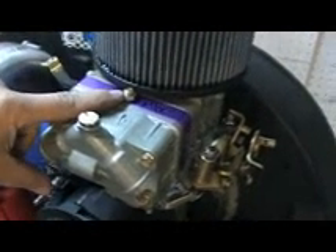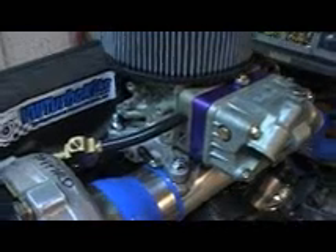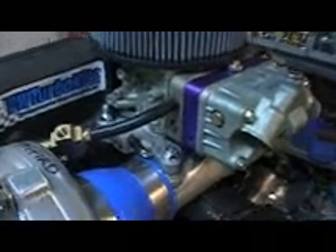You'll actually never take apart the carburetor to change jets because there are no jets. Because of the main jet using a turbo-adjusted jet, if you want to richen it up or lean it out, you just turn the jet. Because it is boost sensitive, it has a normal idle circuit so it doesn't load up like the old-time problems typically when you run Holleys. The power valve system is actually sprung shut and not sprung open.